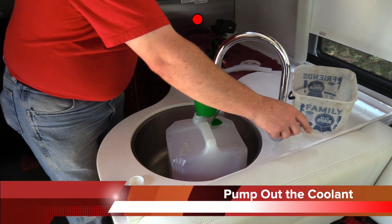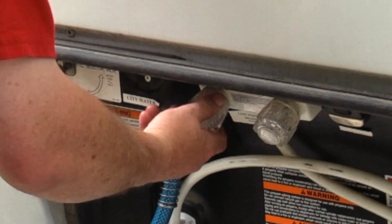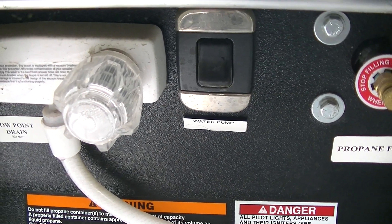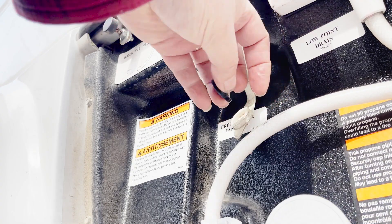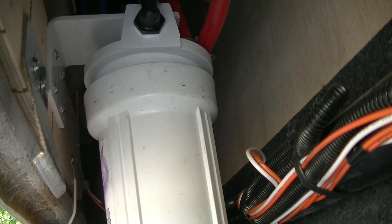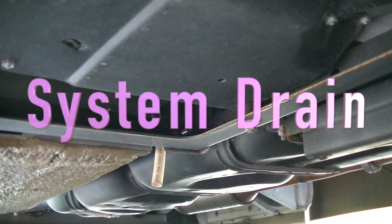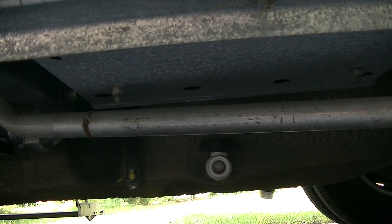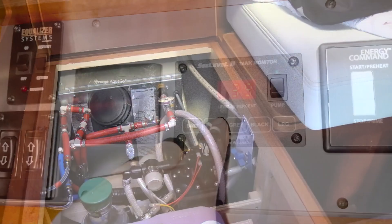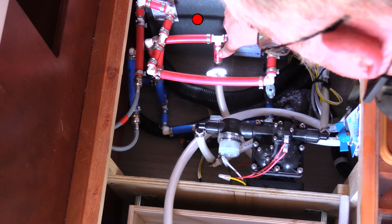Place a suitable container in the kitchen sink, turn on the pump, and open the faucet. Next, place the container under the low point drain and open both faucets and cycle the exterior water pump switch. Turn off the pump and leave the pan under the drain to gravity feed. Remove the filter screen from the water inlet and depress the check valve to deplete any pressure and drain any residual antifreeze. Remove the water filter bowl and recover the antifreeze. Reinstall the filter bowl without a filter and close the low point drain. Place the collection container under the pump drain near the water tank, then return to the pump, open the drain valve, turn on the pump, and observe the sight glass for antifreeze. Turn off the pump when no more pink fluid is seen on the sight glass and it's frothy with air, then close the drain valve and shut off the pump.